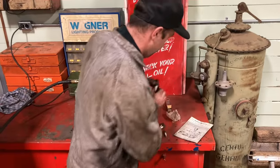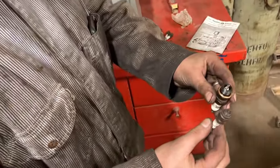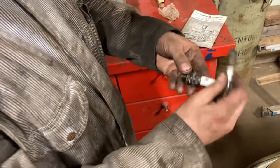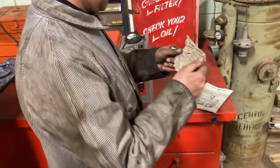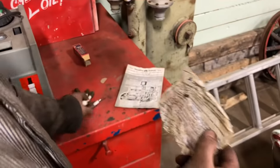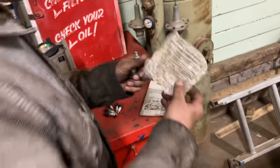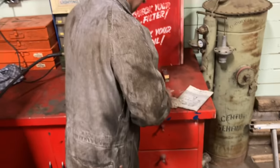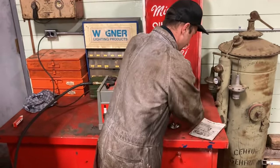As you can see, they're pretty small spark plugs. There's no comparison. It's kind of funny, isn't it? Must be a low-speed plug then. Yeah, Chevy had these until '36, and then they went away. Regap every 4,000 miles. How many times have people done that today? Zero, right? Neat though. So we'll put the high-speed plug away because we're working on a Chevy.